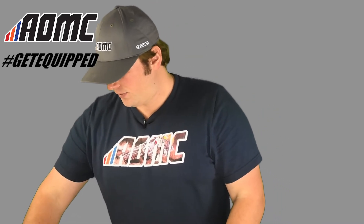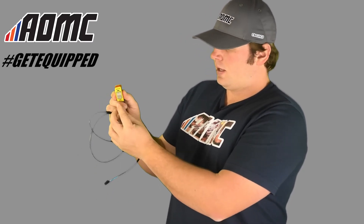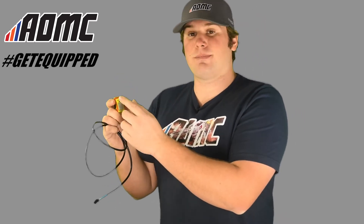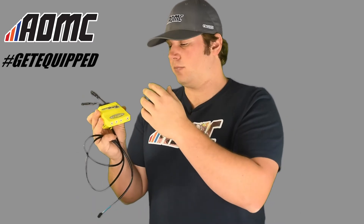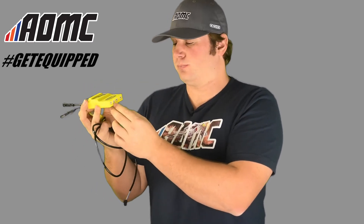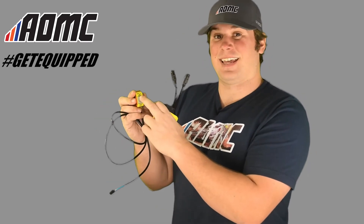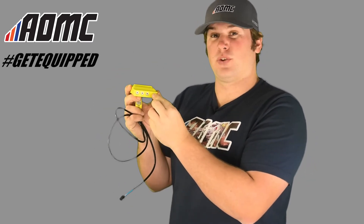There's also an optional Tokyo Mods switch. There's map one at the bottom and then map X10. When you have it in map X10, the motorcycle runs on whatever position you have set on the ignition timing on the ECU. So if you have it on position three and throw the switch into X10, it's going to run with position three. If you switch to map one, it's going to run on position one.